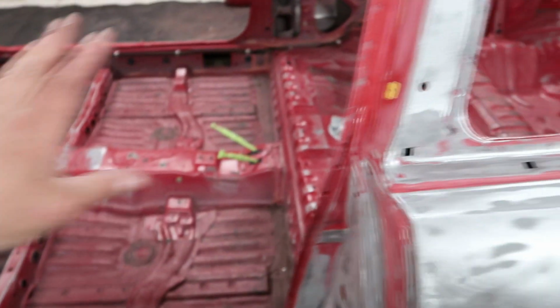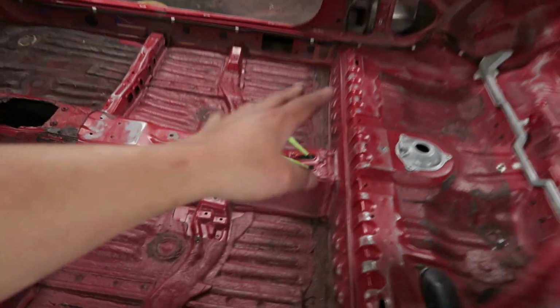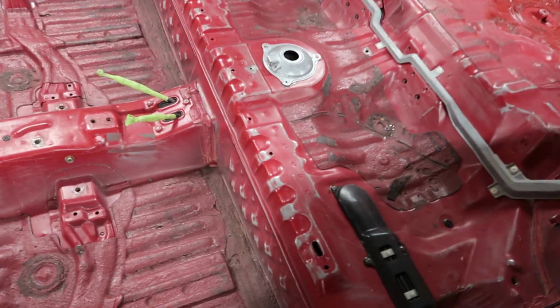But I don't want to get a bunch of overspray inside of here. If you don't know, especially the high build primer, the overspray from it can literally feel like sandpaper. It could be rough as can be. The compressor decided to turn on. So anyhow, we're gonna mask off the windows and the doorways, get this all plasticed off so that whenever I'm working out here, I'm not filling up the inside with overspray. So we have less work to do later.